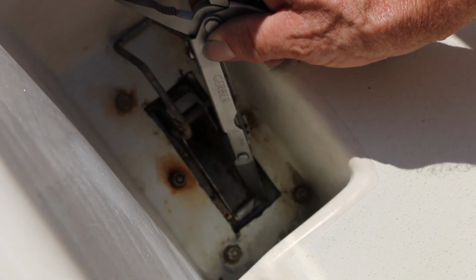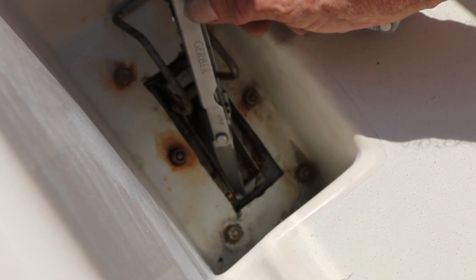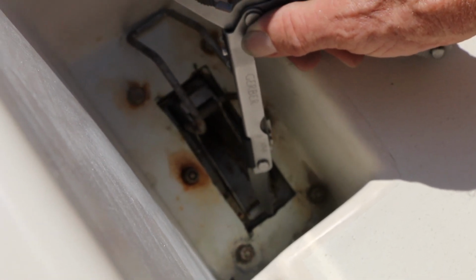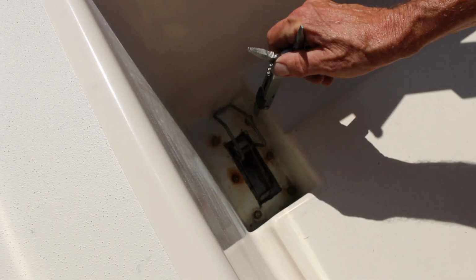As you have water leaking right here, right in this seam. This is where the deck meets the hull. And when your boat is in the water, the waterline is somewhere in here with your bailers open. So that seam's always underwater, and that is where you're taking on water. Remove these 6 screws